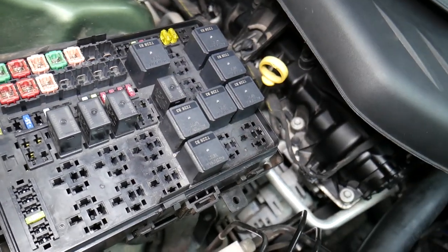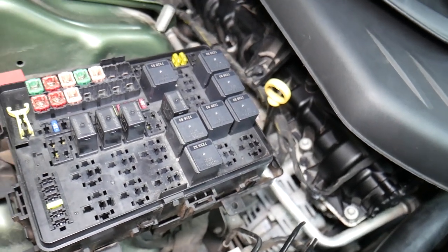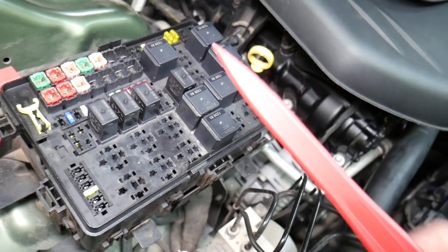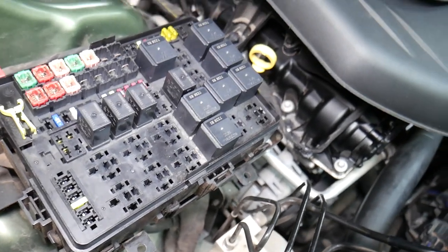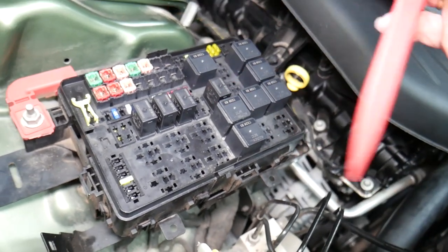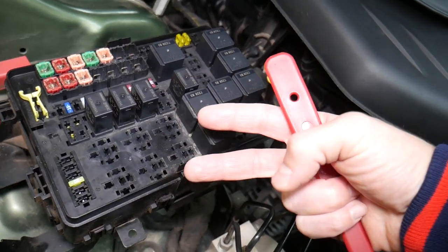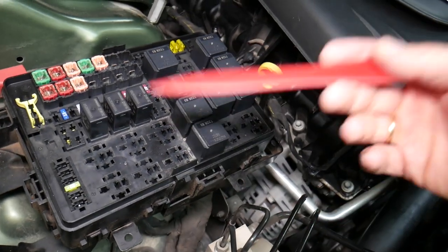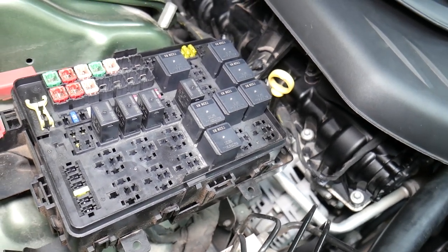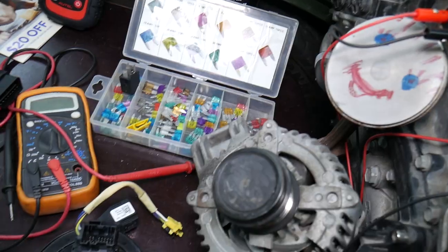For some certain fuses, it's important to disconnect the car battery when removing them, otherwise you can burn the electronics. For instance, when working on airbag fuses or anything like that, you need to wait at least one hour after disconnecting the car battery. If you're not qualified and certified to work on an airbag system, I never recommend doing that. Also, a common mistake people make when disconnecting the car battery: it's important to know which battery terminal you disconnect and reconnect first. If you do it the wrong way you can burn electronics modules — we know because we burned a traction control module on a BMW that cost two thousand dollars. We'll put a link in the description below on which battery terminal to disconnect first.